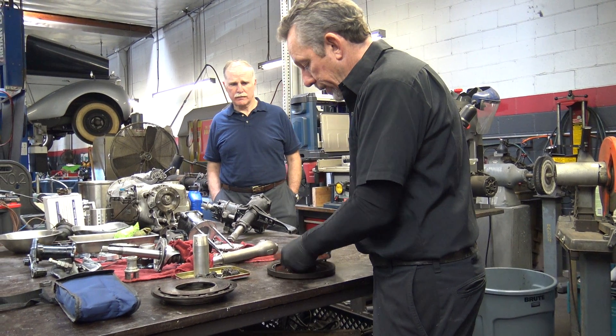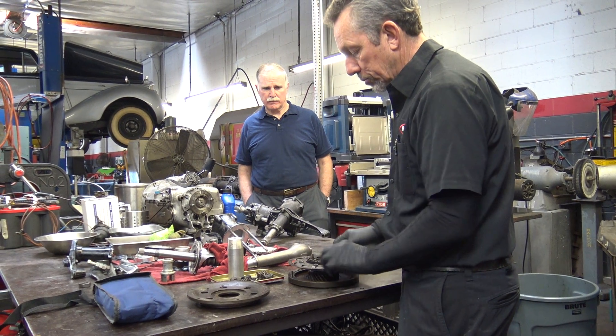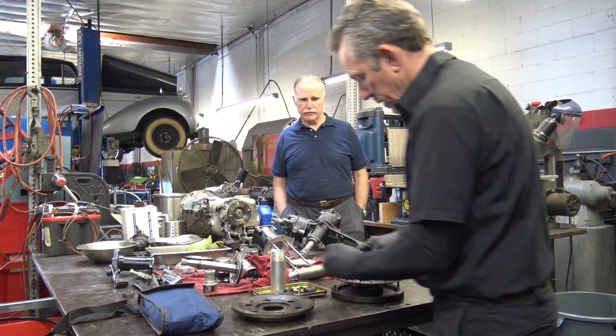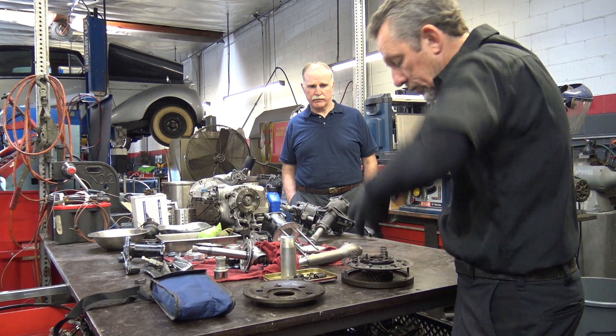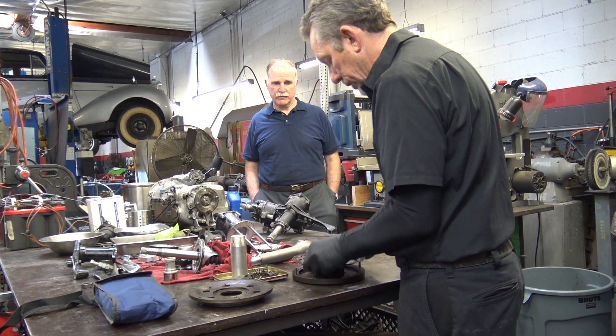These springs and all that stuff in here — there are two clutches. It has a pressure plate here. There are springs that go on here, they go onto these, and it squeezes together. This absorbs the vibration. Now there's a process for testing it.